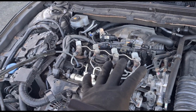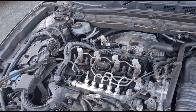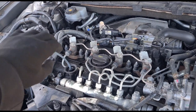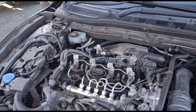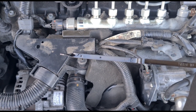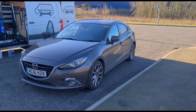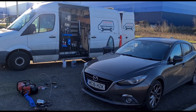The reason for the oil level being high is when you do too many forced regens or regens while driving, some of that fuel gets into the sump — it gets down past the cylinders — and if you do that enough times it's going to raise the oil level. We've removed a couple of litres of oil, so we're now halfway between full and minimum — that's where you want it. Okay, so that is one Mazda — I think it's a Mazda 3 — all finished. We'll see you on the next video.